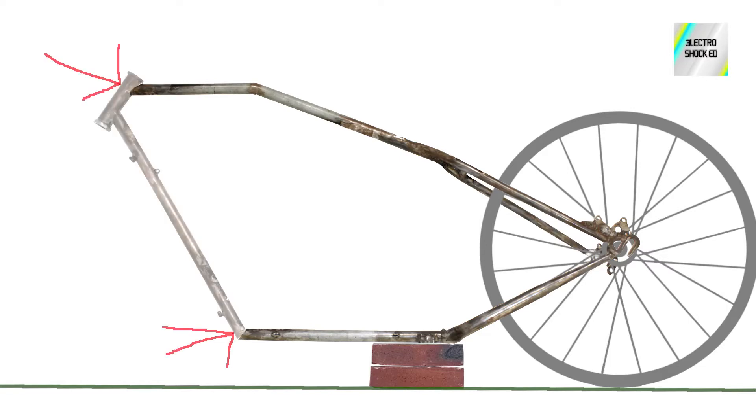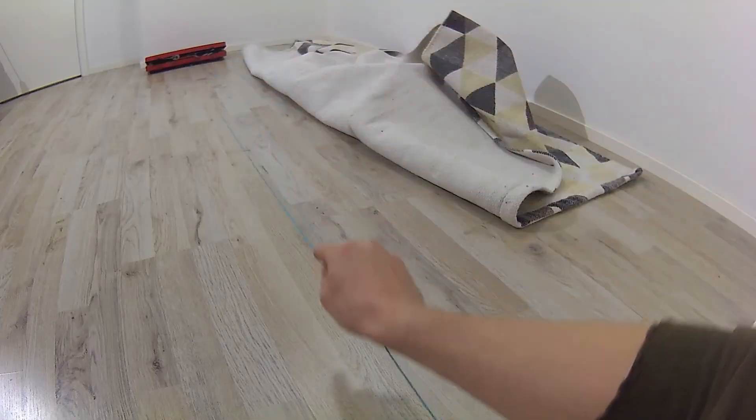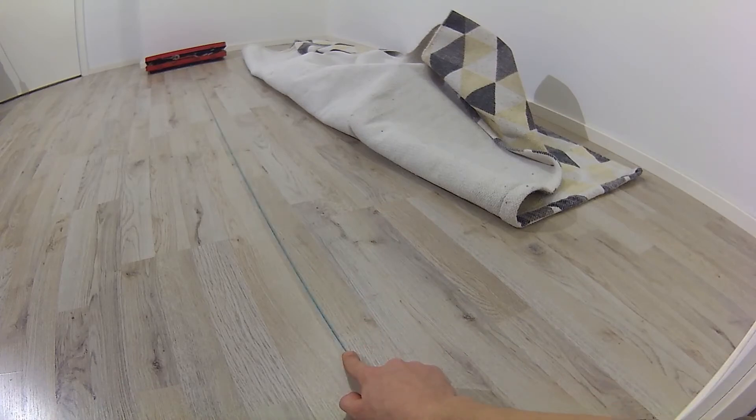Next I made a cut at a suitable height and bent the top tube to connect the end of it to the head tube. Then I looked at where I needed to cut the ends of the top tube and the down tube. I made all of the tube notches with a grinder and a hand file — they don't have to be perfect. Then it was just a matter of tack welding the front of this frame to the rest of the structure. To keep the geometry straight I had to do a lot of eyeballing the alignment of the front and rear wheels, so I made a straight line on my floor with some string.